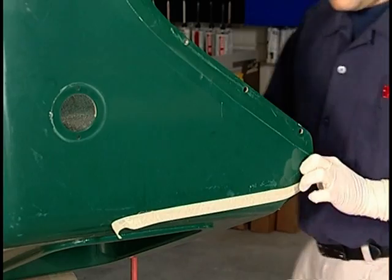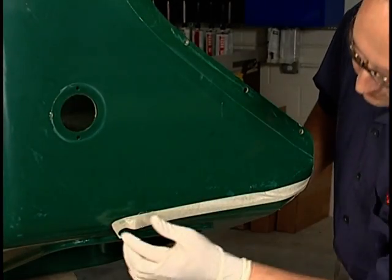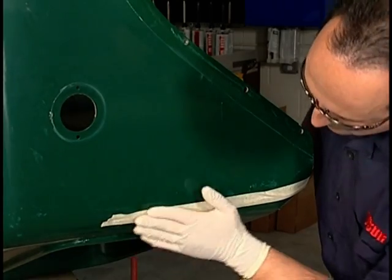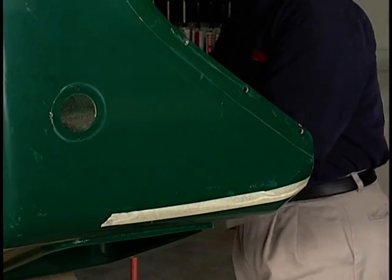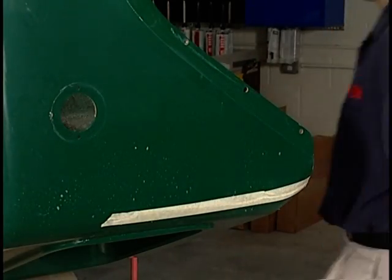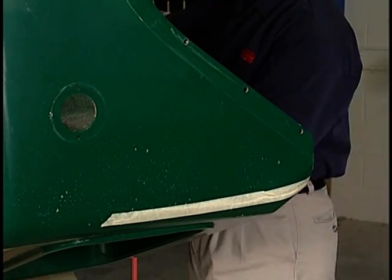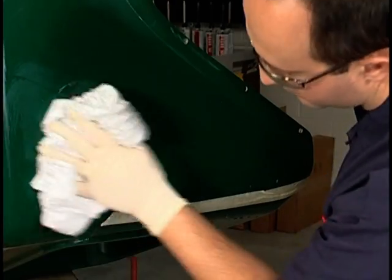Begin by covering the break in the composite plastic with masking tape. This protects the damaged area from absorbing the prep product and eliminates wicking, often associated with poor adhesion. Next, remove all waxes, silicones, dirt and debris from the area surrounding the repair with Fusor plastic and rubber cleaner, stock number 703.